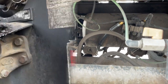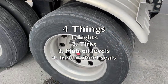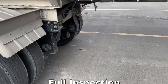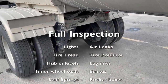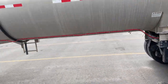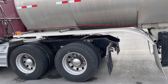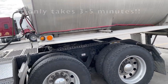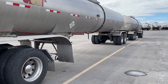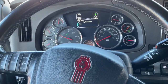Let's recap: I checked four things — lights, tires, inner wheel seals, and hub oil levels. By checking those four things, I really checked everything on this trailer. You'll hear air leaks and you'll know if you have any problems underneath. I did it while talking and showing different steps, but if you do all four things at the same time, you can do this in five minutes or less. If you're doing it every day, you know your equipment really well. Please check every day — we want you to be safe and comfortable knowing your equipment is in good condition.